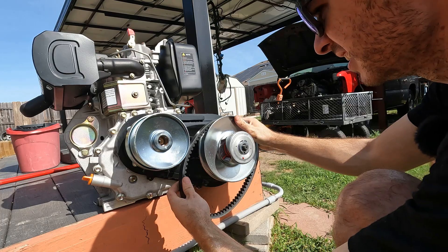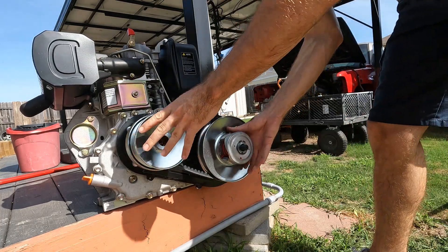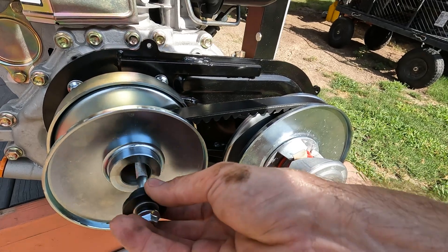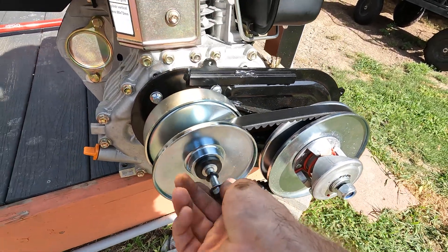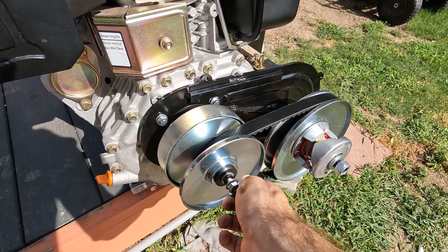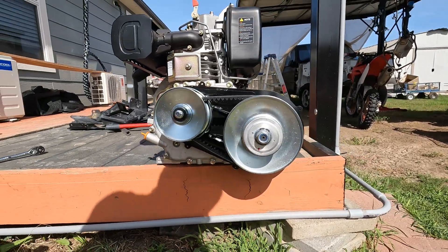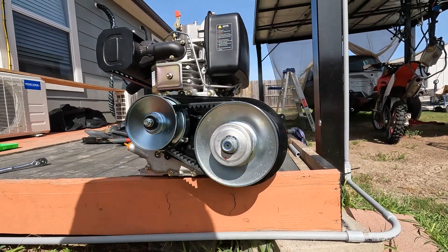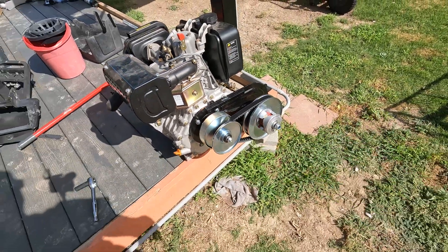The way you put the belt on is like this — and then you have this little spacer right here that's going to take up the slop. I'm very happy to see that you can just buy an off-the-shelf torque converter setup. This is a pretty common big horsepower setup — most people put these on like 420 engines, 459 max performance engines, or any other mini bike big block engine. I'm going to have to put some more washers right here, but as you can see it fits perfect.